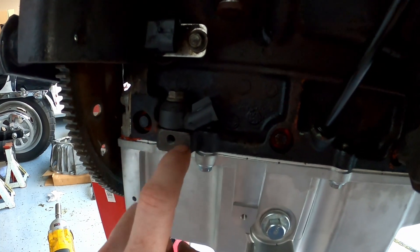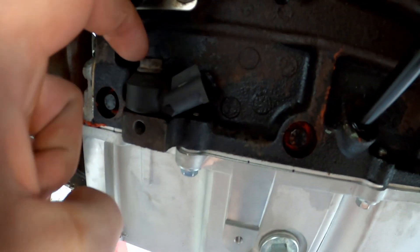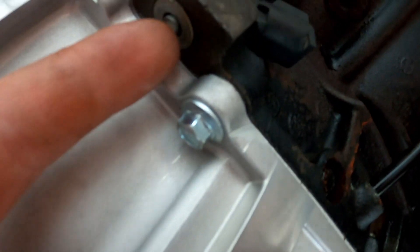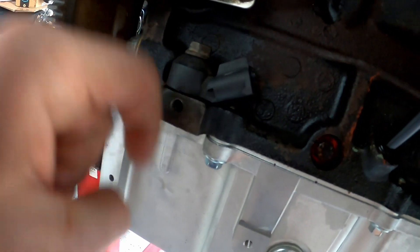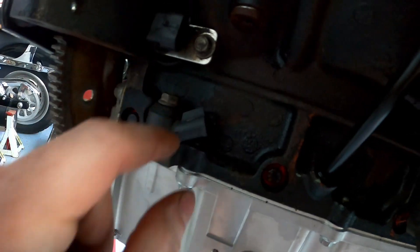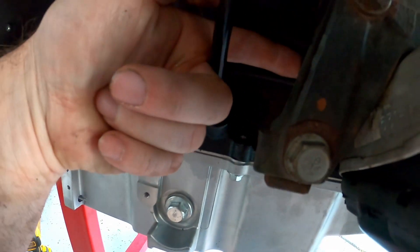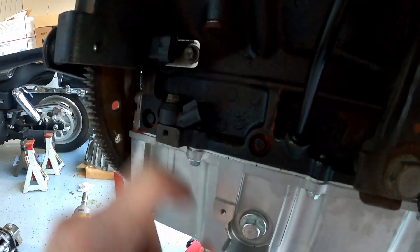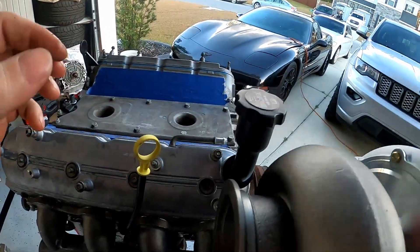I'm not really sure if this is going to work or not, but sound should travel through metal regardless of how the knock sensor is facing. Essentially, if you look inside this, there's a hole that goes through the top. I went through that hole and from the bottom used the nut — the part where you put the wrench on — it fits perfectly inside and actually wedges in there. So I just used a bolt through the knock sensor through here, wedged on the inside. It's a very snug fit, this thing is not going anywhere. I made sure it had enough clearance so the plug can go in and the wiring can tuck behind without issue. It's right next to the crank sensor as well.